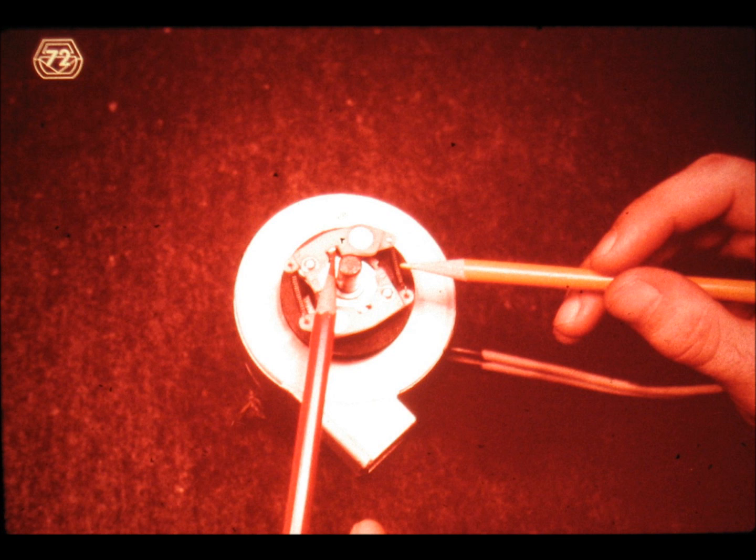The springs on the motor clutch must have exactly the correct amount of tension and length in order to allow for proper motor clutch operation. If they are too strong, the rated RPM of the motor will not be sufficient to cause the engagement between the motor clutch pawls and the motor pulley. This can cause premature wear on the heels of the clutch pawls.